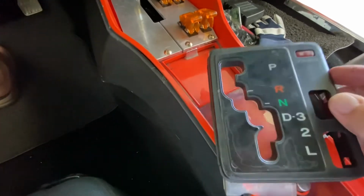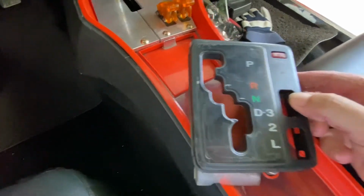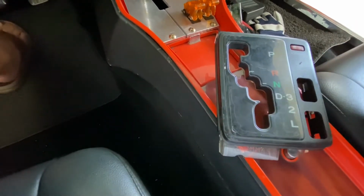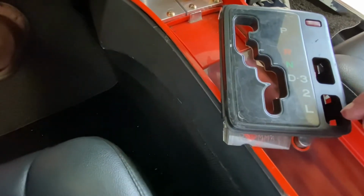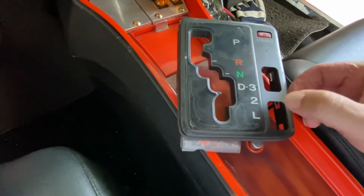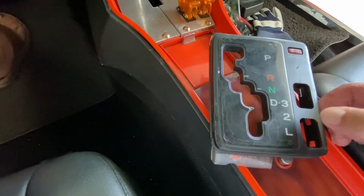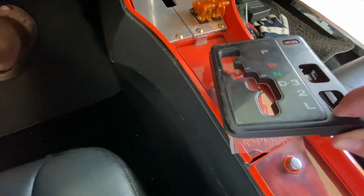And also we have two switches here. This one was the sport and normal mode, which allows the engine to run a little bit higher RPM before it shifts when you step on it. And this one was a ride height adjustment, which is kind of pointless because we don't have an adjustable ride anymore. Okay, and so that we still have to figure it out.